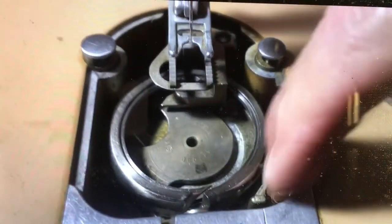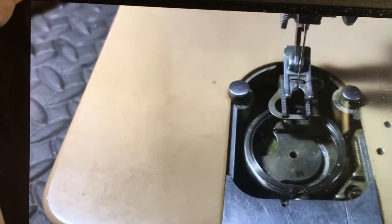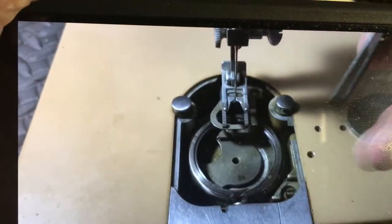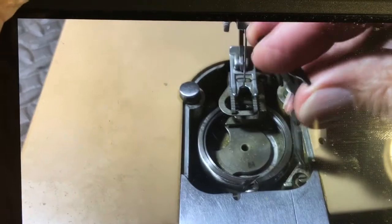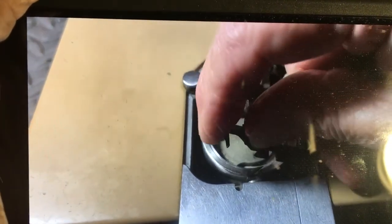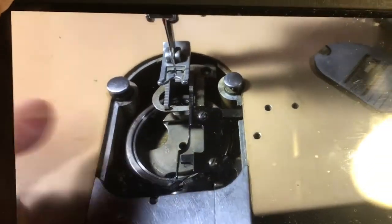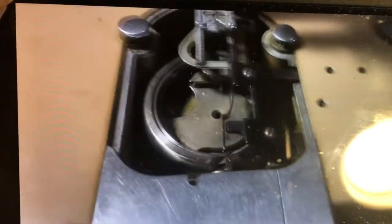Underneath down here, there's a flat piece of spring steel, and this is tapered on the end. See, it has a little bevel there on the left-hand side. It's tapered, so it slides above the screw and underneath the edge, and you bring it in at about a 45-degree angle, and you'll feel it pick up that little piece of flat steel under there. And then it locks down into place. It'll snap down in on this little post here for the position bracket to be in place.